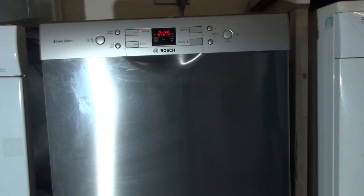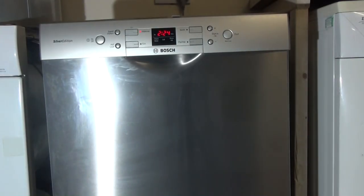I'm wondering what has caused it to trip. The detergent dispenser still hadn't opened. So I'm wondering whether it was right at the start of the wash — either the main wash, or it's gone during the pre-wash. This is what we're going to now see. Five minutes into the pre-wash mode, I'm going to leave that going and we're going to see where it's tripping. I'm wondering if it actually tripped at the start of the main wash, or when it starts heating — the flap opens about two minutes after the main wash starts.